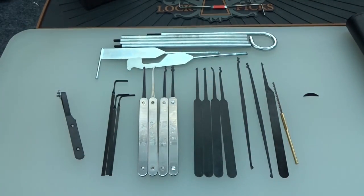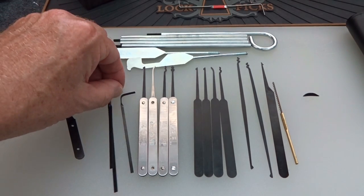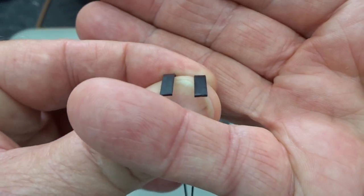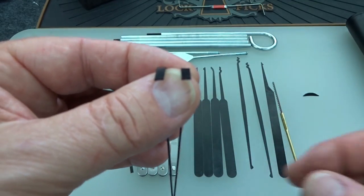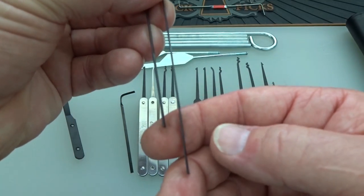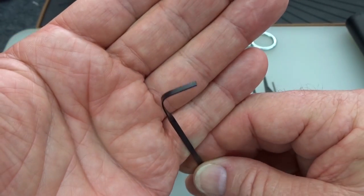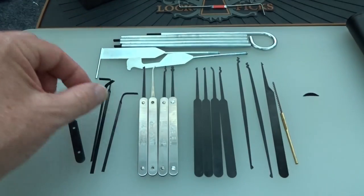You also get three tensioners. I thought it was a large, medium, and thin one, but I took a close look and measured them with a micrometer — these are identical thicknesses. Two of them measure 0.125 inches or 3.2 millimeters, and the only difference is one is almost exactly one inch longer than the other. There's no medium thickness, but you do get a thin one that measures 0.095 inches or 2.5 millimeters. No medium tensioner — maybe you don't need it on cars.